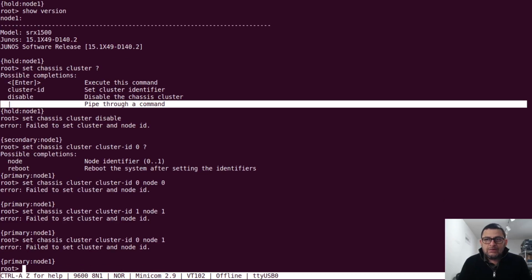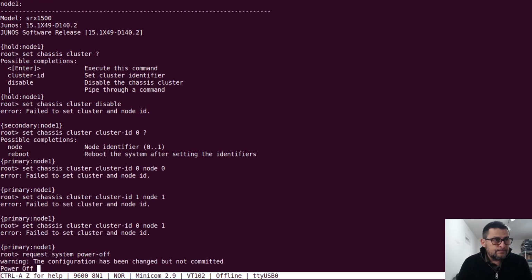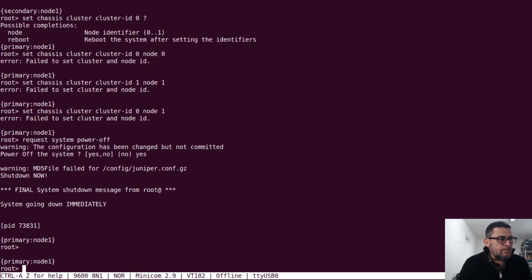At this point, the only solution is to download the image file from Juniper Networks, create a bootable USB. I have videos on my channel in which I explain how to execute that, and then boot from the USB and erase everything. Let me show you how to do that. Request system power off. Yes, and then I have my USB right here with me. So I will insert this into the USB, boot from here and erase everything.